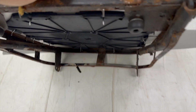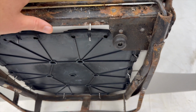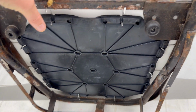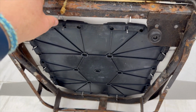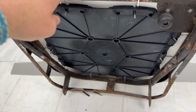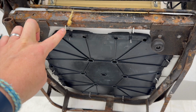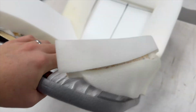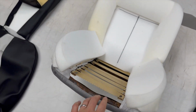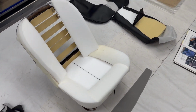Then on the bases, you've got the diaphragms. Obviously diaphragms do come with new clips and fairly straightforward. They just clip all the way around. Sometimes you'll find that the diaphragm doesn't want to be clipped in sequential order from hole to hole, so sometimes it's actually best to start off with the extremities, to go from one edge to another edge, and same again the other angle. And you'll find that because you stretch it to the ultimate extremities, it then stretches out nicely in place in between all the fixings, so that's always worth it.